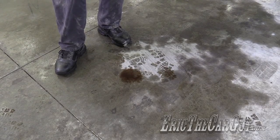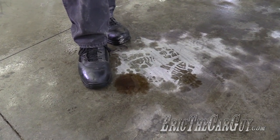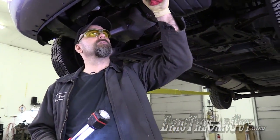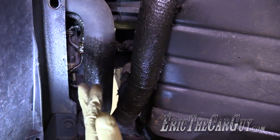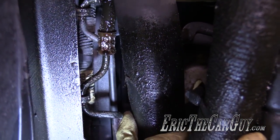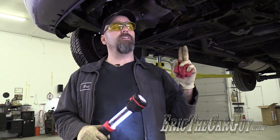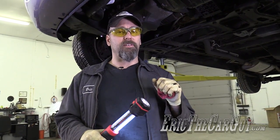During our period of running the vehicle on the lift and filling it up with fluid, there appears to be a puddle of transmission fluid here on the floor. When I look up underneath the vehicle, what I ended up finding was a lot of residue on the lower radiator hose, but also above it on the transmission cooler lines. I believe that to be the source of the leak that caused the transmission fluid to get low. The transmission fluid got low, and after that the transmission wasn't long for this world. I'm going to condemn this transmission here — based on all the evidence, this transmission ran low on fluid, it doesn't have reverse, and this is an internal mechanical issue.